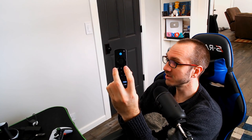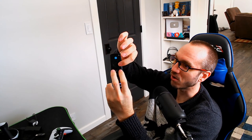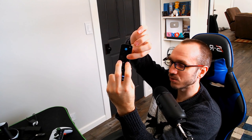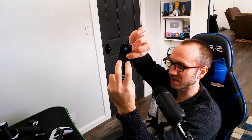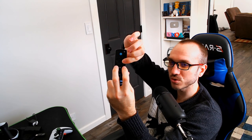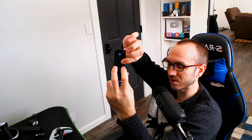The other thing you can try is resetting your Amazon Fire Stick remote by pressing down the back button, the button with the three lines on it, and the left button. Hold all three of these down at the same time and your Fire Stick remote will reset and disconnect from the Amazon Fire Stick. It may scroll up or go to the home screen on your Fire Stick when you reset it.